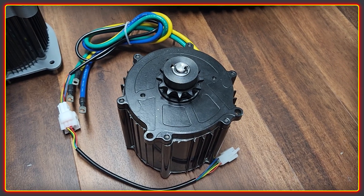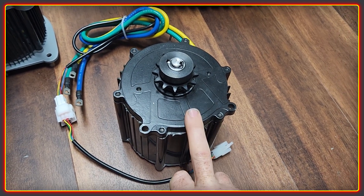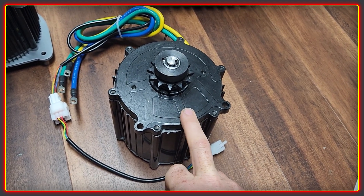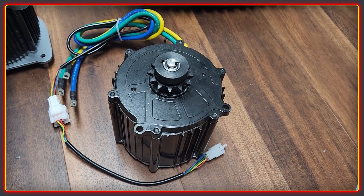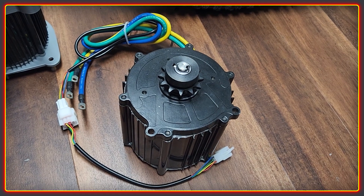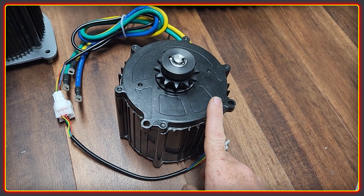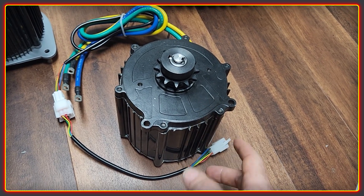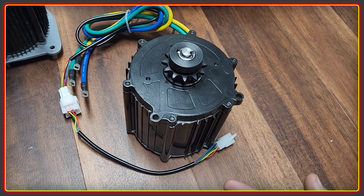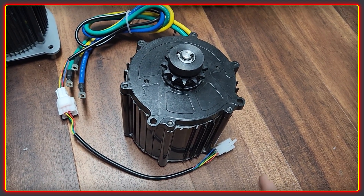Welcome to the High Voltage Light Electric Vehicle channel. This is the largest of the Lightning Rods big block motors that we've had in testing since late January. We have a pretty decent testing rig at High Voltage which we use to help map and tune these motors to work well with the ASI controllers. The next clip has the motor under load testing at 15 kilowatts, coming out at 55 newton meters of torque.